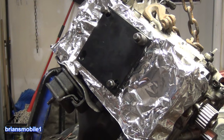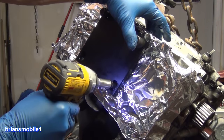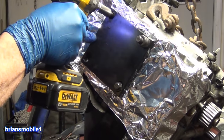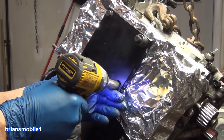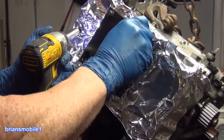It's a half inch or 13 millimeter socket. And it doesn't say exactly how to do them as far as the torque goes. So I just snug them up, I give them three ugga-duggas. I'm guessing that that's somewhere in the neighborhood of 15 to 20 foot-pounds of torque. Just spin this. If you can't spin it, then probably you're torquing. If you're torquing, you're probably not straight.